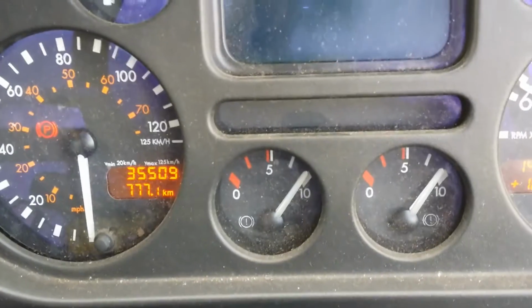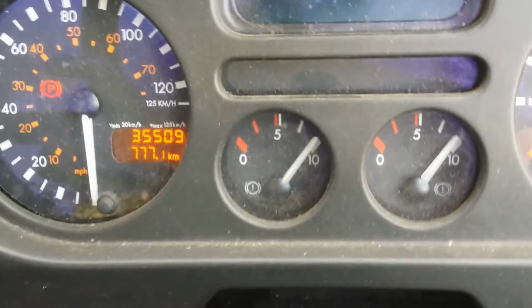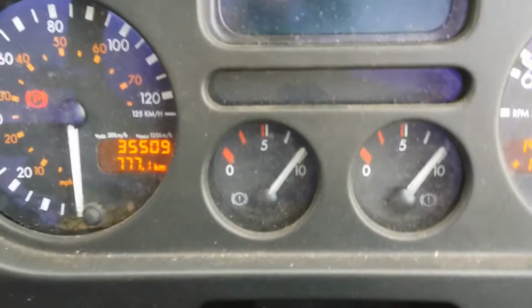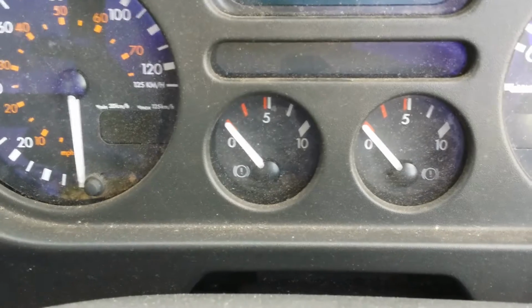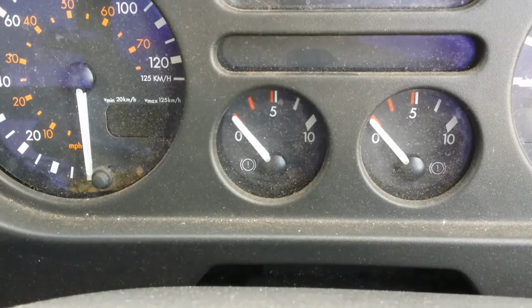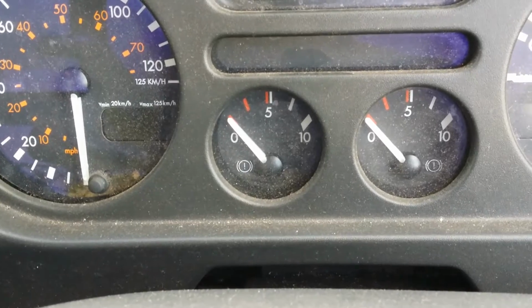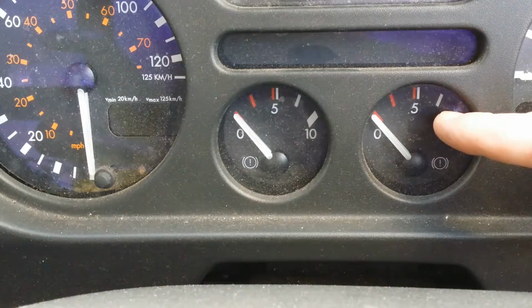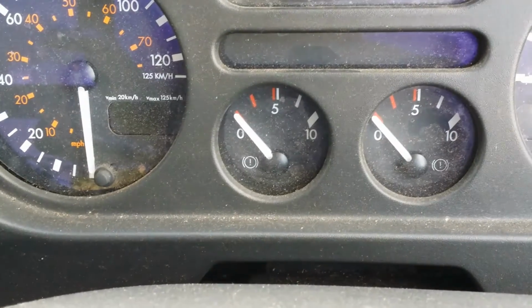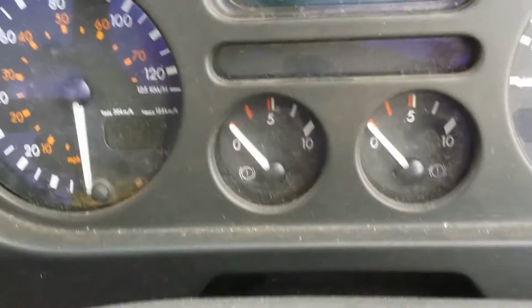Do not worry if it starts beeping. These two dials here are your brake pressure indicators. Now, if the van has been stood for over a week, these will not be fully charged, and you may have to wait 5 minutes. If you try to set off before that dial gets past this area here, the lorry will not move. It will feel like the brakes are stuck on.